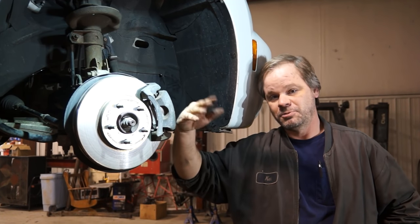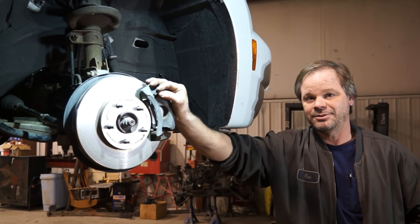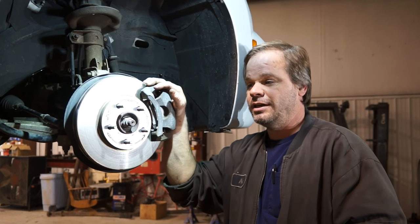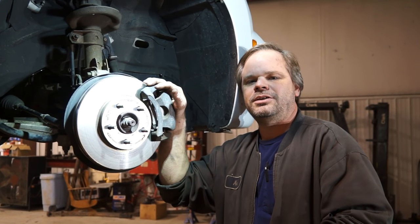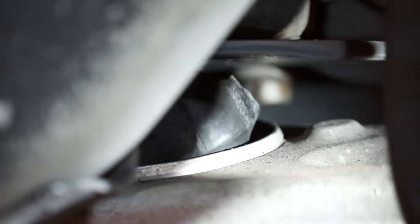The reason we're replacing it is because the bushings wear out, and then you get a whole bunch of play like what you can see there. You also feel it when you're driving — when you hit the brake, you kind of feel an extra little jerk, and that's the wheel moving from the torque of the brake being applied to it.